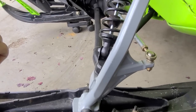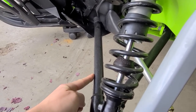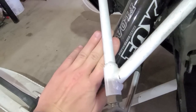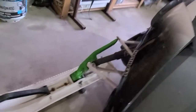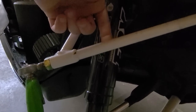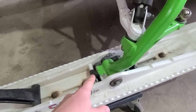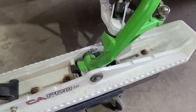That's something we really want to watch out for because it means the sled's probably been crashed pretty hard. Hopping over to the other M8 — this one is configured completely differently so the gap is tighter. Checking the other side: the gap is the same, which is good. On this ski, we can see the rubber dampener is completely destroyed — it's sticking out both front and back. That ski dampener will need to be replaced. Fairly cheap and easy to do — a minor repair, but something to be aware of.